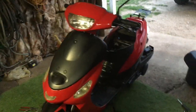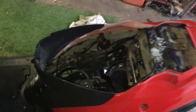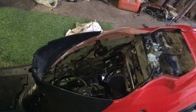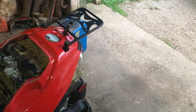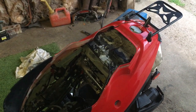But there it is — it is done. There's the seat for it. So if you have any questions, go ahead and get with me if you need any measurements. Like I said, I used the stock frame mounts off of the original VIP 150cc. This is a long case engine, by the way — this isn't a short case. If you wanted to, you could probably run a short case engine; you'd probably be able to keep your back fender. I think the short case ones only had one rear shock, so that would save you from having to add another shock in.